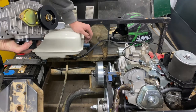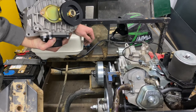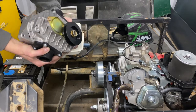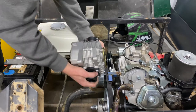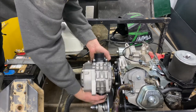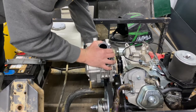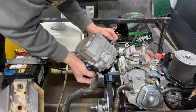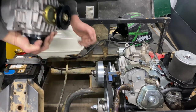This really sucks. I've been so keen to get this thing on here, but I just do not think it's going to work. It is actually too big for this application. It is a tiny supercharger, but even mounting it either way, we're going to block the intakes or outlets, or we're going to hit the engine. Even if we dropped it down and ran it off here, it's just going to put too much stress on everything.